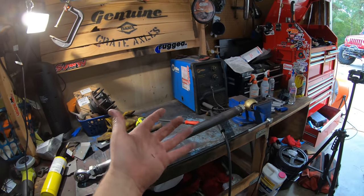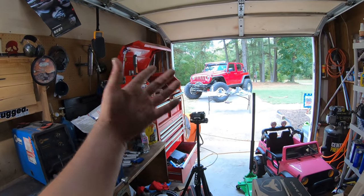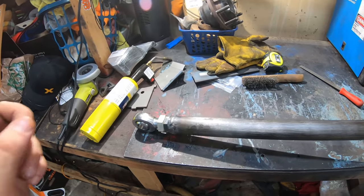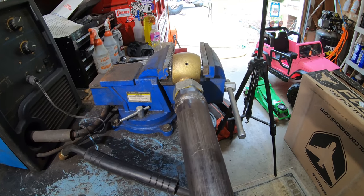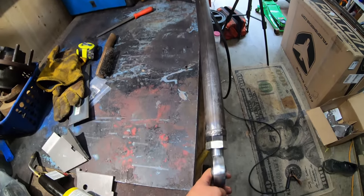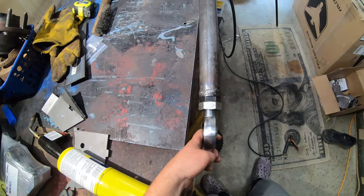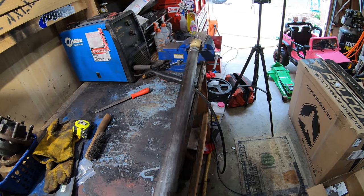The lower link is complete. Before doing the second link the same size and length, we're going to pull this over to the Jeep, hold it up, mock it up, and make sure everything looks good. Let me show you this offset joint — right now it's in zero misalignment state but the bar is off to the side. This is how it's going to look under the Jeep since our cross member mount is moved inboard. That way it's not already in misalignment and we still have plenty of wiggle room before it maxes out.